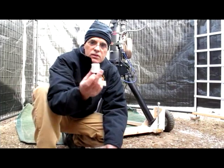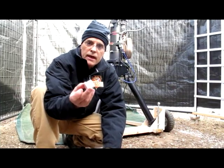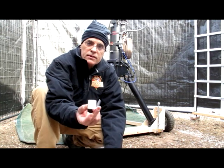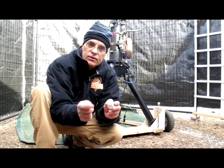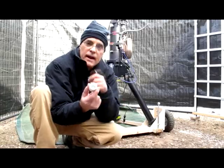That was a piece of cake — rolled right in there. So all I've got to do is level the jacks. I've got these little one-inch PVC end caps and I put this underneath the 5/8" screw jack. It fits right in there and gives it a larger foot. It also protects the screw jack from grinding and digging into the dirt and the threads, because it'll spin on the bottom of that PVC cap.